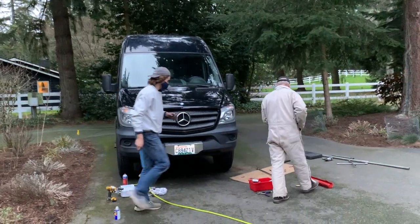Today, just have a little bit of follow-up to do. The tires were torqued on there so well. They were like 300 foot-pounds. They're supposed to be 135 foot-pounds. So I'm gonna fix the rear ones just in case I ever need to change a tire on the road and I don't have all the tools I need to get 300 foot-pounds of torque removed. So I'm gonna loosen those up and then tighten them correctly. And then just gotta get going on a bunch of projects inside. Gotta start putting things back in, get the headliner shelf in, go to Home Depot.